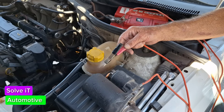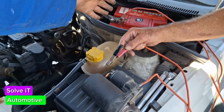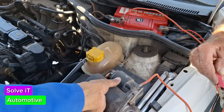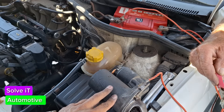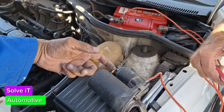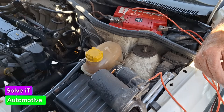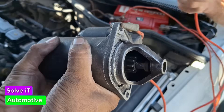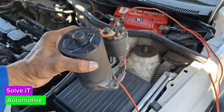What we're doing now is testing the actual starter. There are a couple of ways of doing it. You can use your battery – we've got the battery cables connected in the right order: negative on that side, positive on that side, and our negative earth joined to the body of the starter. The first test is just whether it spins. We've installed our new brushes, so let's check – hit it. You can see it goes forward and comes back again.